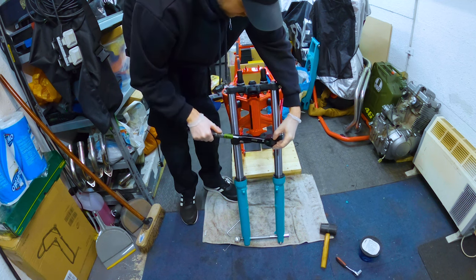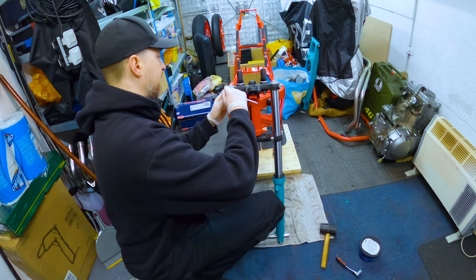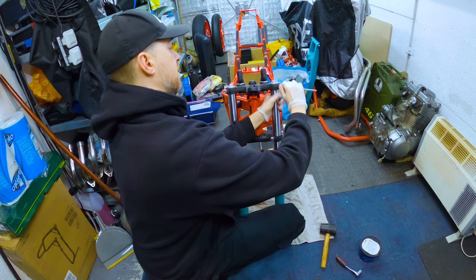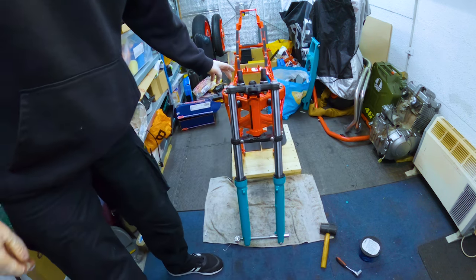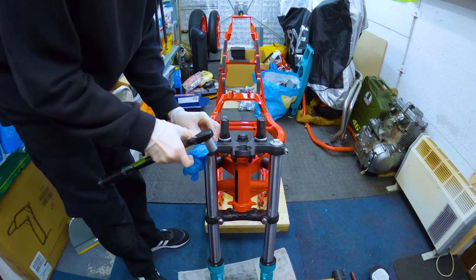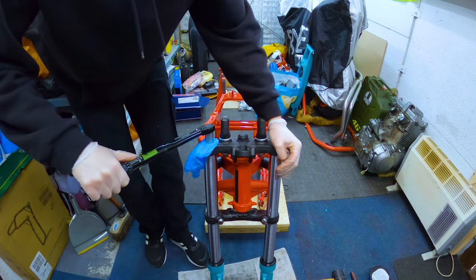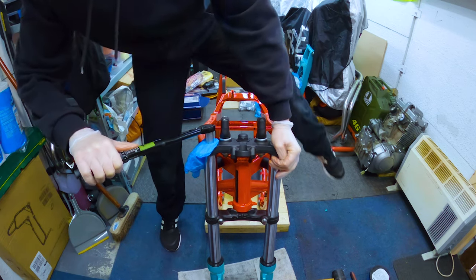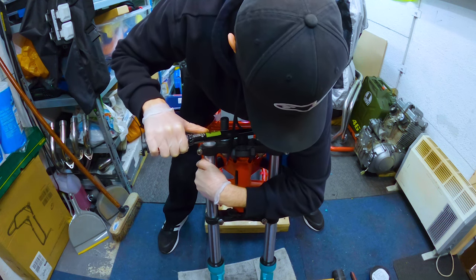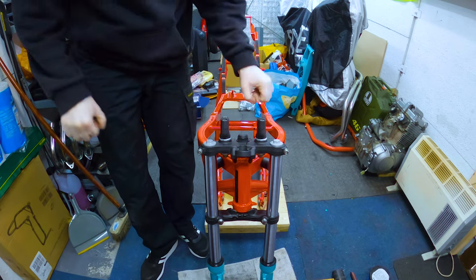Okay, that's one done. Next one. I'll nip these ones up by hand for now. I'm going to torque these up and then torque that up last — and that's the front end done. I'll put a rubber glove over the top just to stop it from scratching the paint on it. These are only 20 Newton meters so they shouldn't need much at all. I might actually struggle to do that one because it needs up to 105 Newton meters and I've got nothing to grip, so I've done it just hand tight for now — I might have to get that one done later on.